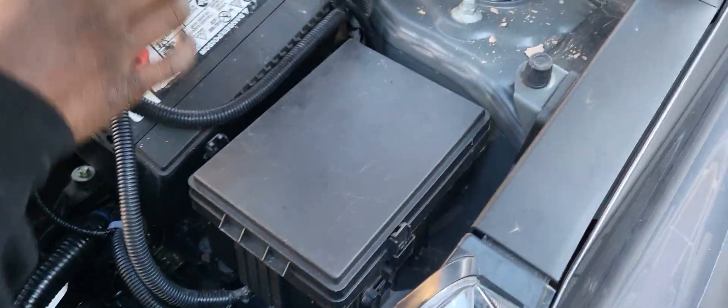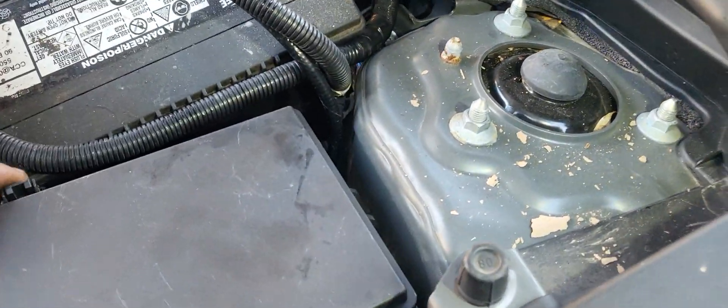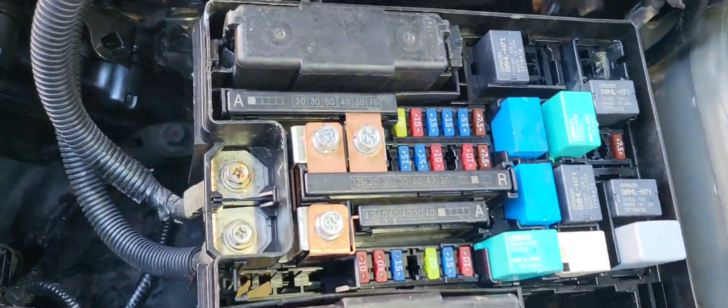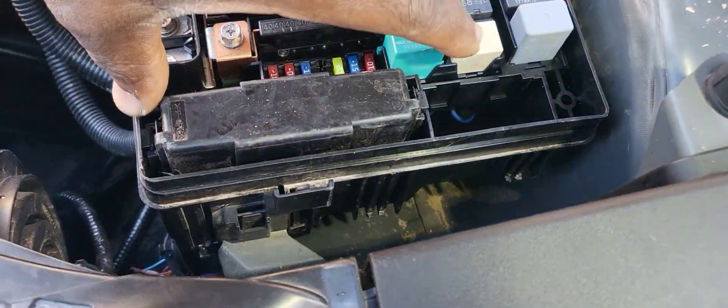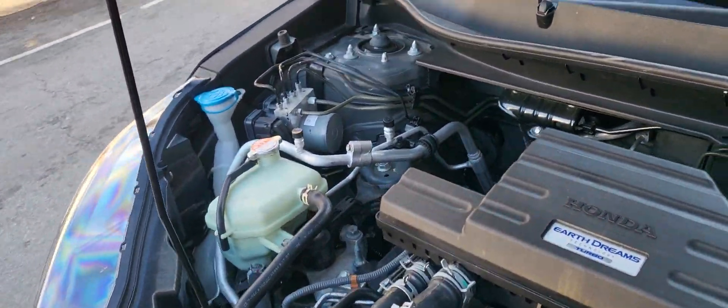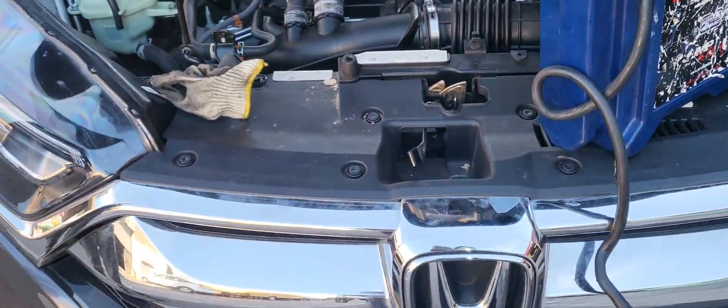Water cars — yeah — water cars is a waste of time. Listen, the car starts — you want to see it? Let's push it inside. The car is starting, now the car starts — I agree — but he cannot see the immobilizer. He cleaned all this stuff and even now there is some water there. That doesn't mean that you're going to be okay. This car is water damage — you put a new computer or used computer — just get the wiring good, get everything good, communicate with the car. With water and computers it is not easy. Right now I'm not able to talk to the car at all — it's not communicating.